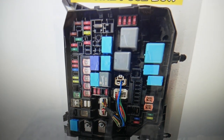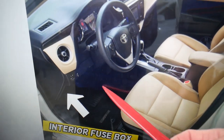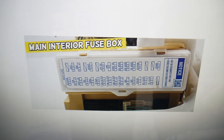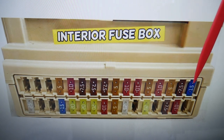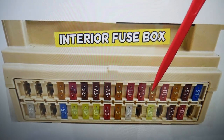Next, open the driver door and come under the dash on the bottom side. Look upside down on the bottom — you have one white cover that looks like this one. Pull it out and underneath you have a fuse box layout. Counting from this way: fuse number 21 will need to be checked.